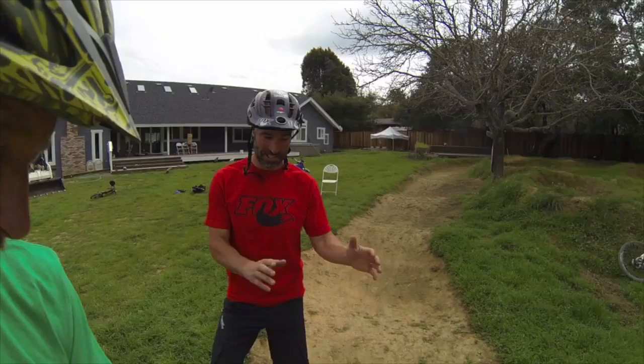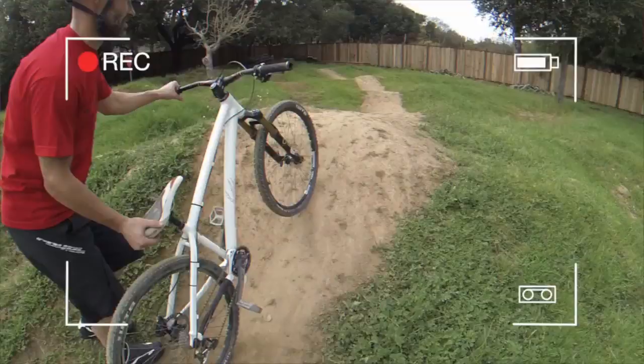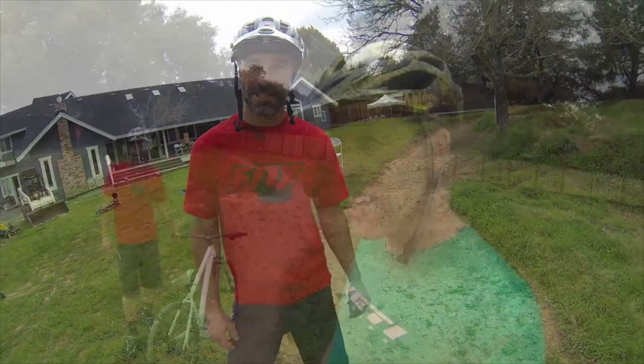Is there something I should do with the bike setup to help me — should I cheat a bit? Yeah, instead of using it like a bulldozer, one thing you can do is stiffen up your compression on your fork. Because you are pumping on a trail bike, you want to make it as stiff as it can be — like a hardtail with a short-travel fork.